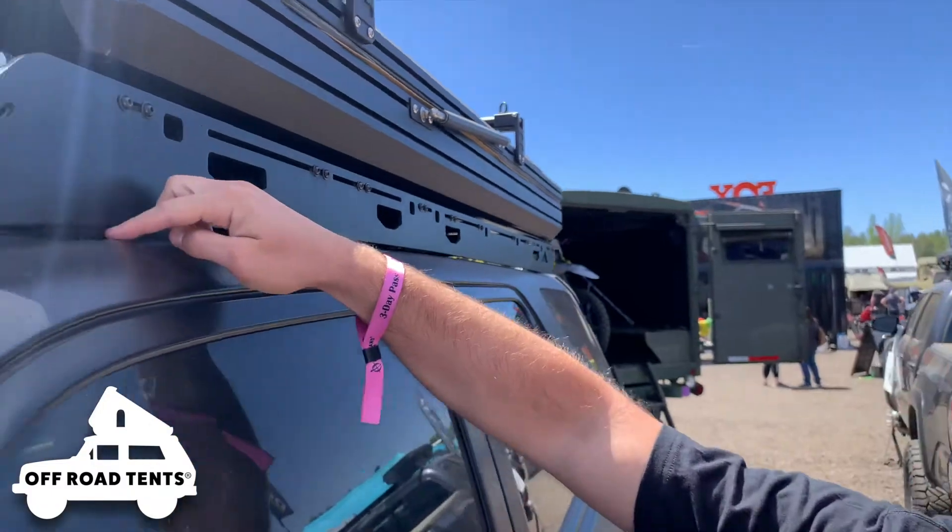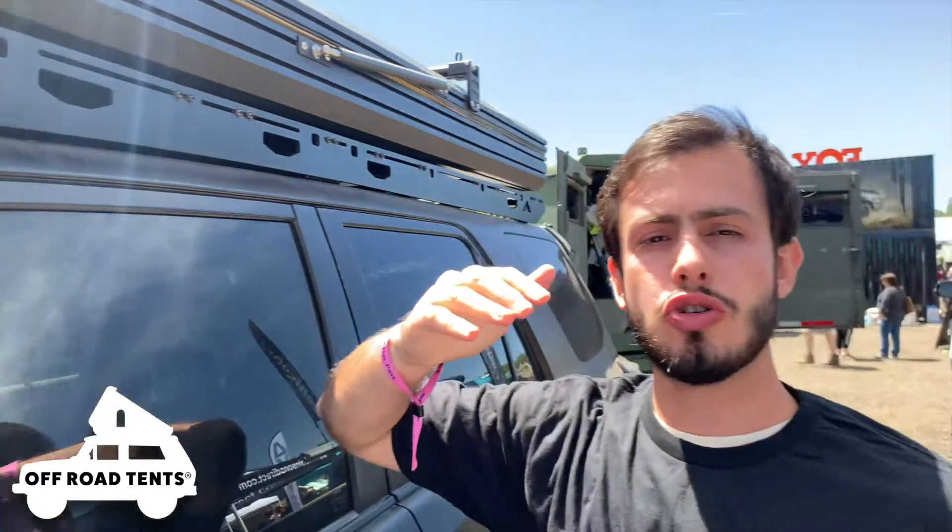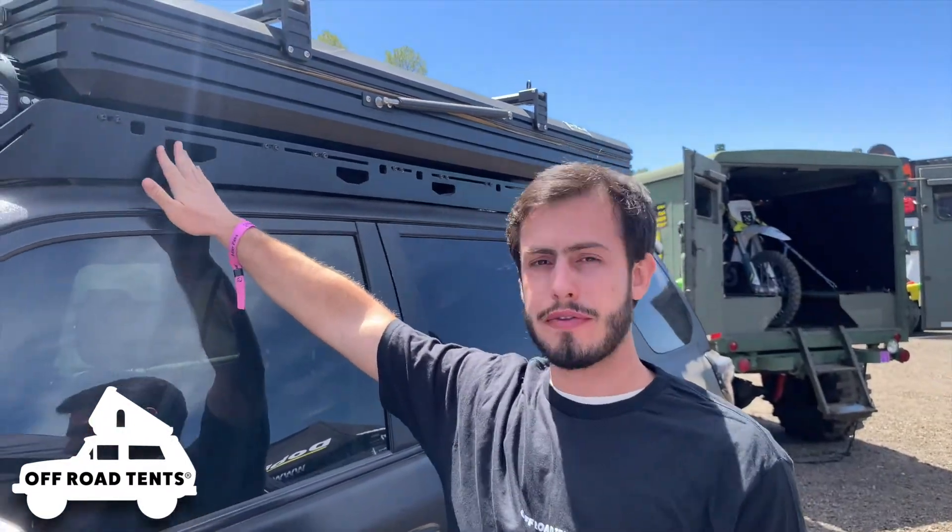The roof racks all have rubber seals where the rack will be mounting on top. This is a 5th-gen Runner, and when mounting most other roof racks, you either drill onto the roof or mount them onto the existing mounting points. However, the rack itself can be heavy, and when you add a rooftop tent, lights, or gear it gets heavier. After a few years, when you remove the rack, you'll find the weight has caused the mounting points to stretch, bend downward, or make the holes bigger — that's not the kind of abuse you want on your roof, as it's unsafe and allows water and dust in.